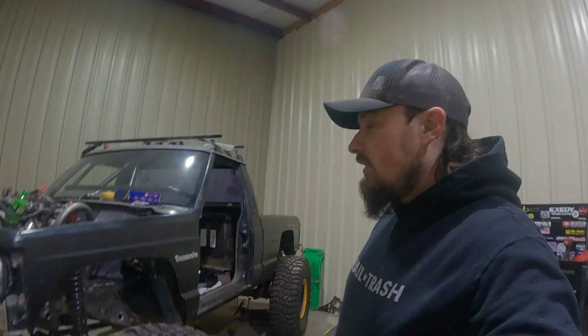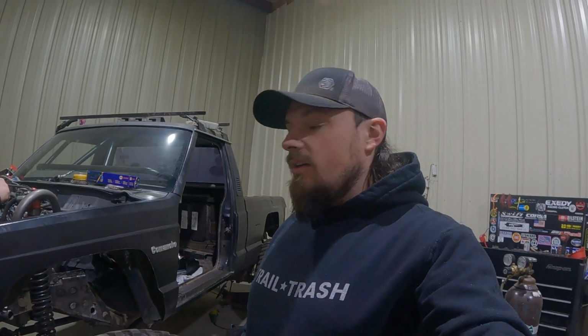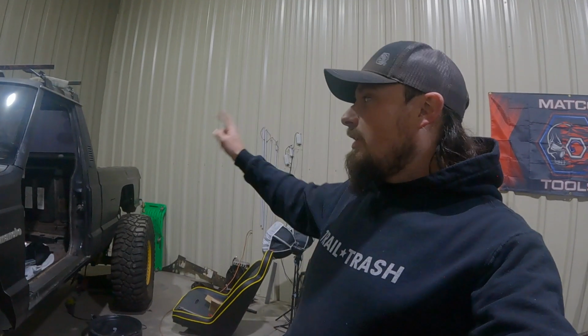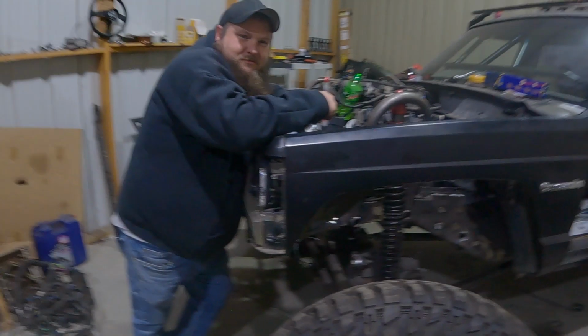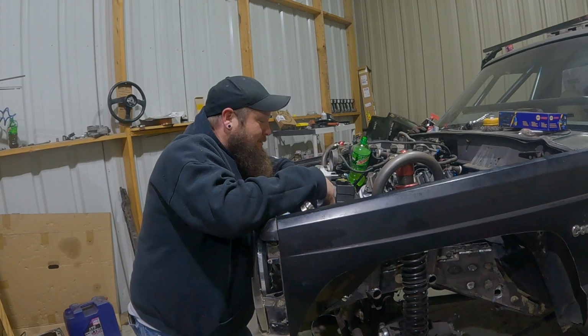Okay, we're back. The last thing you saw was we pretty much determined that the fuel pump was dead. The new fuel pump wasn't dead. We flipped it around, rewired it, no change. So I left, Casey stayed to pull that fuel pump off, and made the amazing discovery that the pinch off tool got left on the fuel line. So if the pinch off got left on, then we weren't gonna get no fuel. Took it off, ran it a couple of times, we hit 46 PSI.